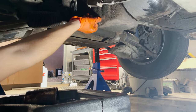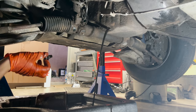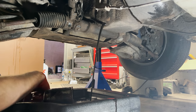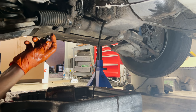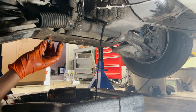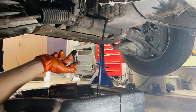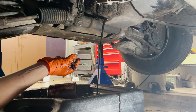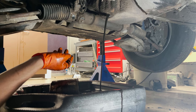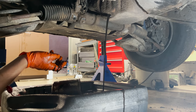Let's see what the engine oil looks like now. It's oil. It's dark, but at least it's got oil in it. That's a plus. This doesn't look magnetic, but there's not a lot on this, so that's a decent sign. I'm not seeing shards of bearing material or anything come out of it. Engine turns over and it doesn't look like it's pouring all the bearing material out of the oil pan. It might be onto something. Maybe we can get this thing fired up — maggots of power.